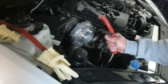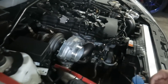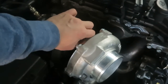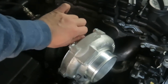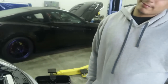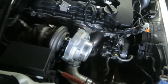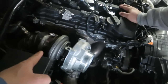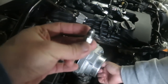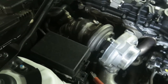I was held up like this, and as soon as we tried to put the feed line fitting, it didn't fit. I don't know why the hell they want to use a different size. Precision's the one that's actually using a different size, because the Garrett is the original one. So this is 7/16-24 or something, and this is 1/8. This is the Precision feed fitting, and this is the Garrett one.